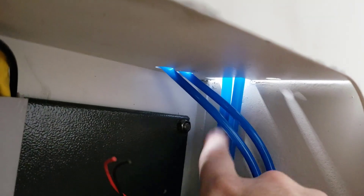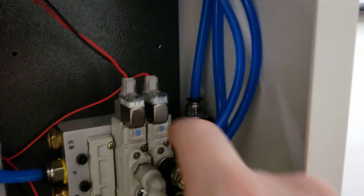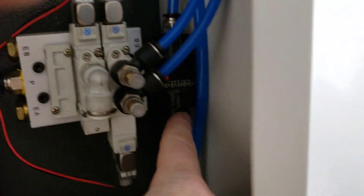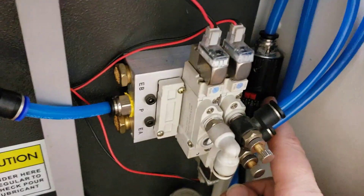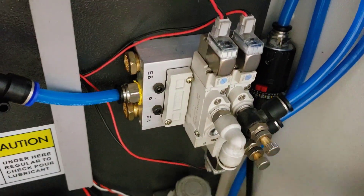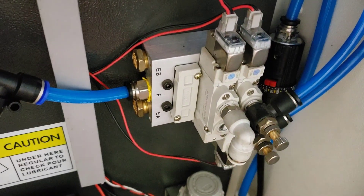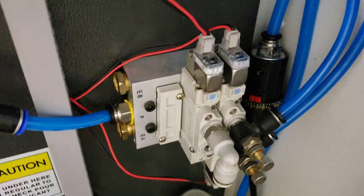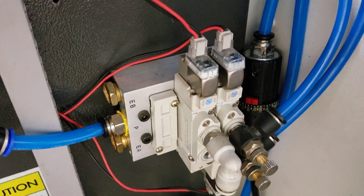So you come down into here — there's your two hoses: power drawbar and mister. The mister — I put an inline regulator in my mister. So if I wanted to run the mister at no more than 70 PSI, I could do that. There's actually a little nozzle to control it at the mister itself, but this just gives me machine-level control. Like, do I ever need 100 PSI going to the mister? Probably not. So let's just not let that happen. I think I actually have it set at 95 right now.